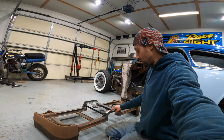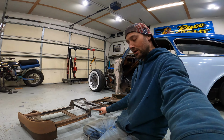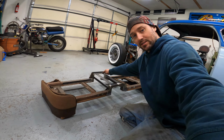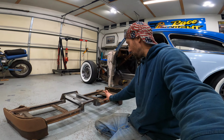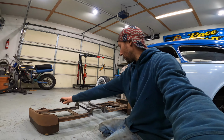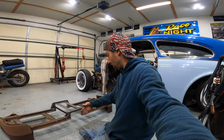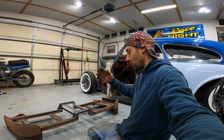And once I got those pieces in there, then I built these plates for the front and the rear to create a third dimension to brace it. So this thing is nice and sturdy. If it was just these pieces of flat stock, it would be all wobbly. In fact, it was. Now to get this thing square again, I just used some 2x4 metal tubing with another tube across it and used some big C-clamps to make sure that this was parallel to this and was parallel in the other plane too,